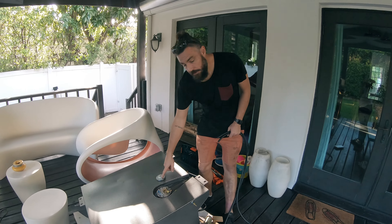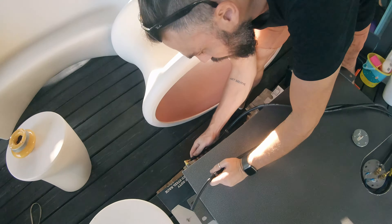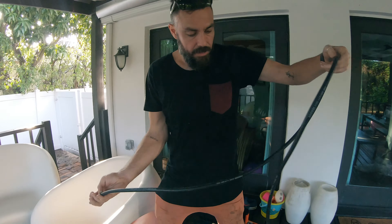Now that the fuel sending unit and fuel pump are pre-attached, the 8mm hose that attaches to the existing tube coming out was actually a repair by somebody else. With the new fuel tank there are two vacuum lines that have to come out of the opposite side, so I'm going to pre-run the lines to work out where not to get them tangled when reinstalling the tank. I've put the clips on — one's going to go on the side like so, and I'm not going to cut the other until I'm sure I don't need it for something else.